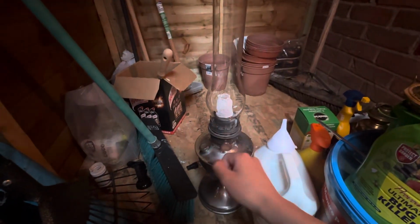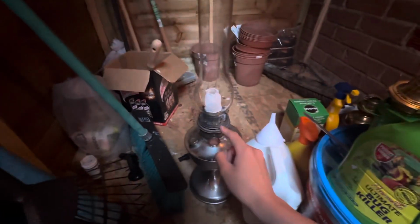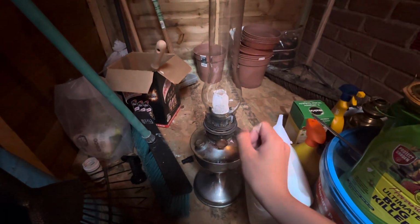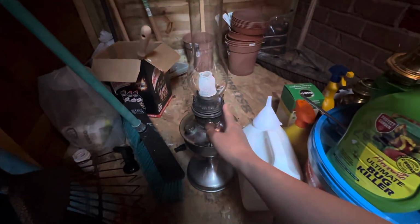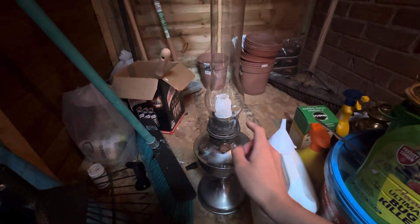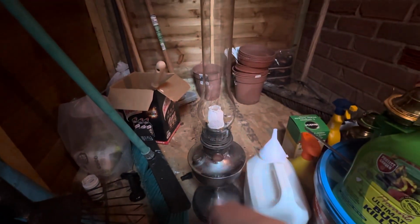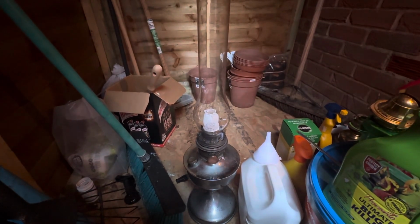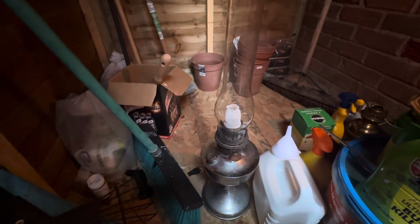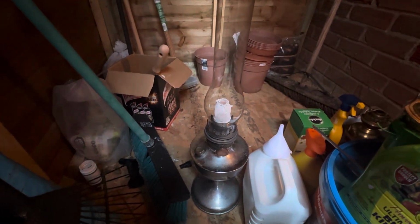In order to get the best glow, you also have to meddle with the flame spreader. The flame spreader actually adjusts the characteristic of the blue Bunsen flame. This oil lamp actually produces a really hot Bunsen flame, the blue flame, in order to use a Welsbach mantle. It's by Carl Auer von Welsbach of Germany, who previously invented the mantle with a mixture of rare earth thorium and cerium oxide, 98 to 99% thorium to 1% cerium. But right now the mixture is being changed to yttrium, since yttrium is not so radioactive compared to thorium.